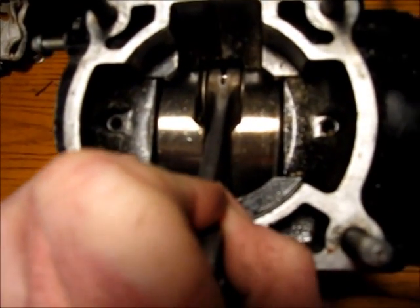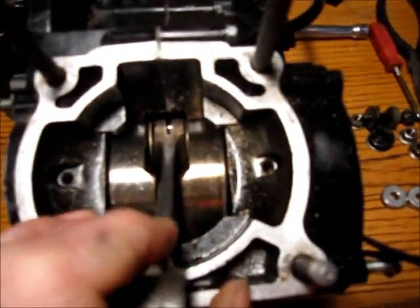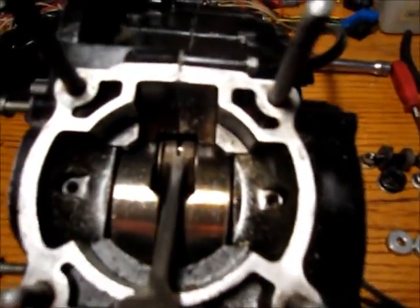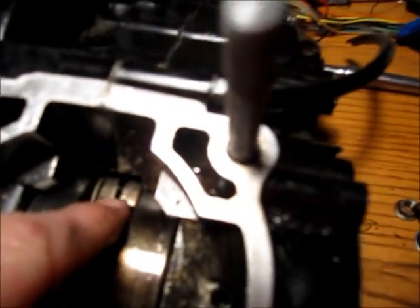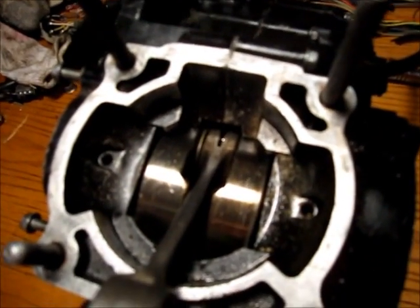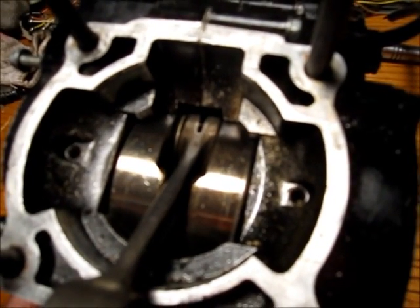When you do that, push forward and backwards. This one actually has some play — there's definitely some wear. I wouldn't run this engine. I might even be able to hear it a little bit. This one would run if I put it together, but its lifespan would be very limited. And then, once this bearing goes out, it wreaks havoc on the rest of the engine as well, because shrapnel goes flying throughout the engine, and then you have a catastrophic failure.